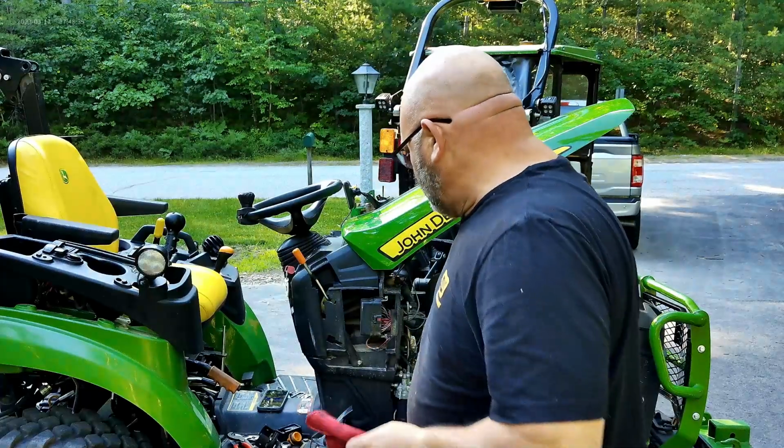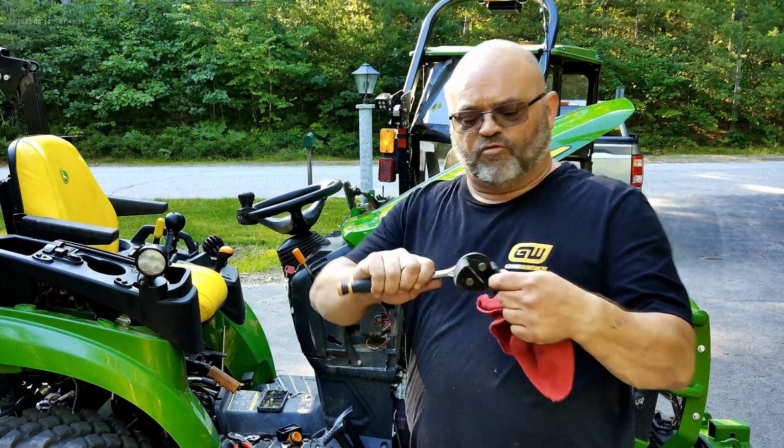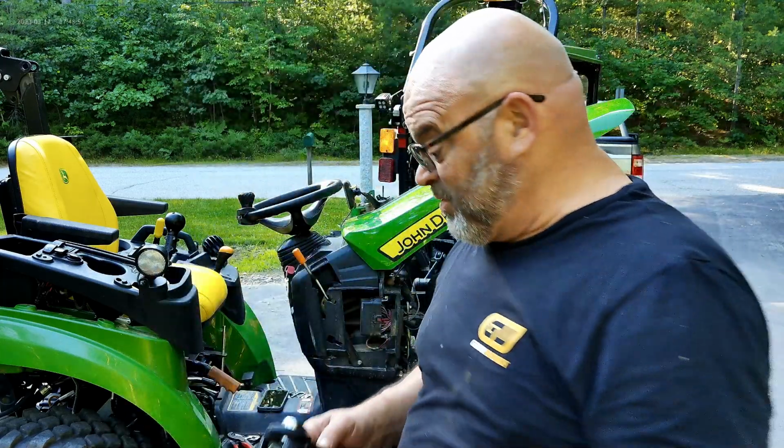And you're going to need some sort of an oil filter wrench. I use this one. I like it because as you tighten it, it expands and then it tightens down on it. You can use the regular old style. You can use pliers. And if you're really desperate, you can actually punch a screwdriver through it and twist it. That makes a mess, but it works.